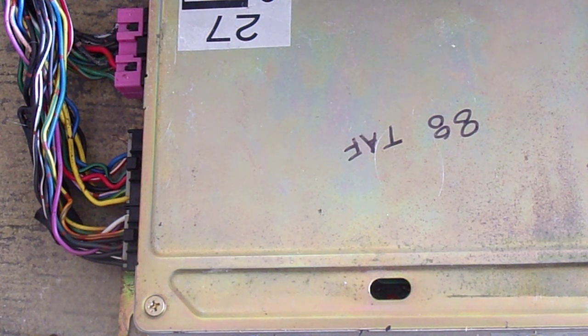One thing I can think of is it's right next to the distributor, so I'm going to try repositioning it and then resetting it. Let's try that. I mean, everything else is right. I don't know why it would do that. That is really strange. All right, we're going to turn everything off again. Unhook the battery. I'm going to double check that resistance. 23, 26.